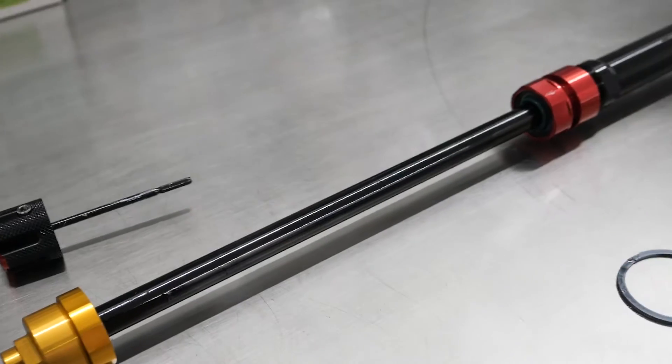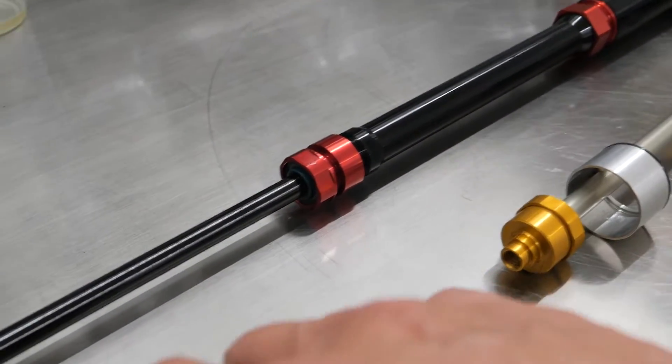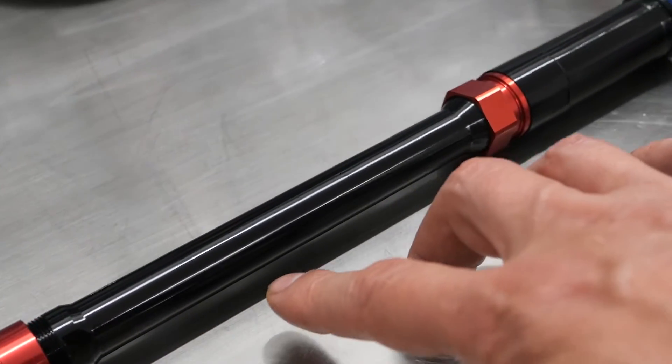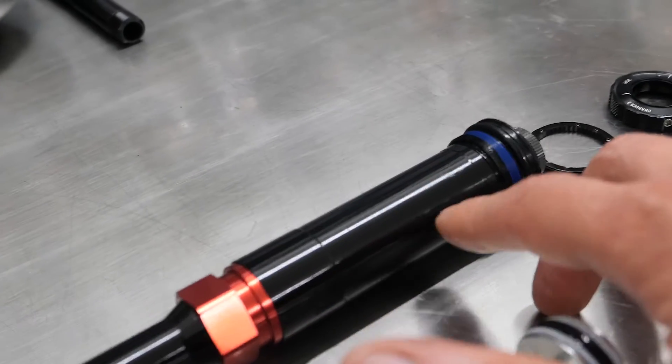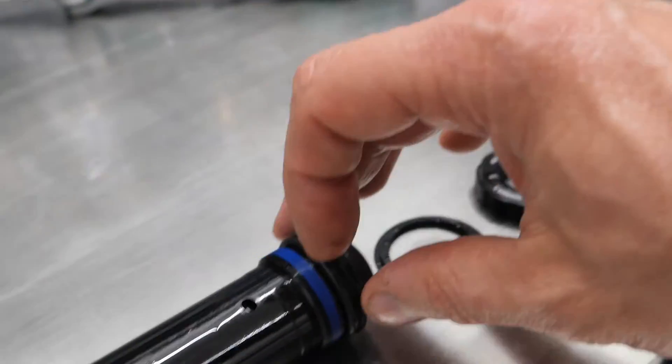If you're going to upgrade these, you need to upgrade both the damper and the air spring — you can't just upgrade one or the other. Coming up this, you can see a much more durable design on this damper — no bladder, just using that coil-sprung design.